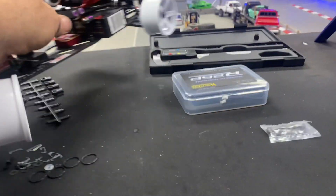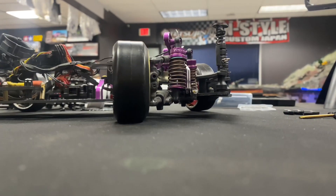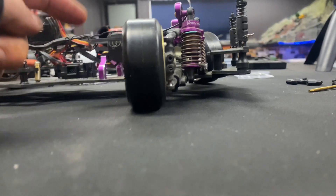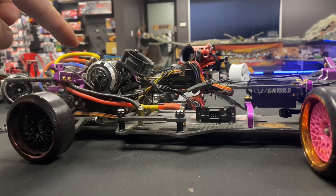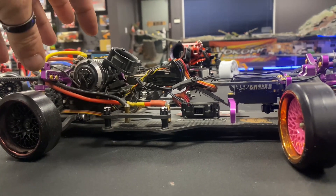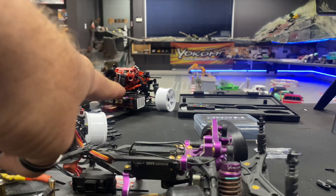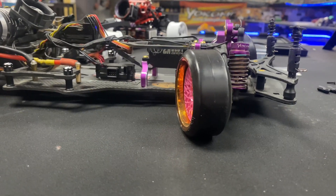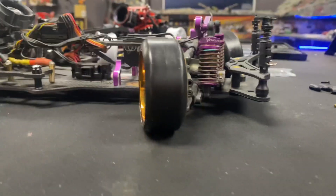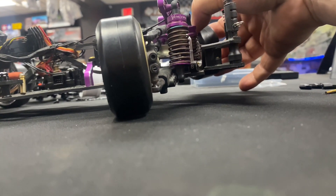If we take this tire out of the picture and look at this one — yeah, that's flat, that's flat at max lock, and that's more lock than you'd ever need. Forget about that outer tire because this is a weight shift setup on the SX. There's more weight shift in the MD than in this one — that's why they designed it that way, so you can move the weight all into the back. When you throw it in, if you move the weight to this corner — even better if you pick up this wheel — you can see guys three-wheeling. Look how high that tire is off the floor. That's pretty flat.